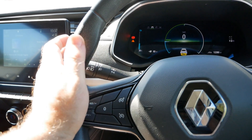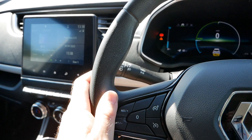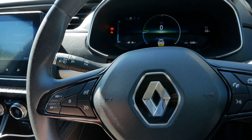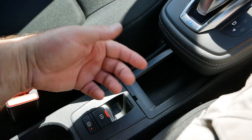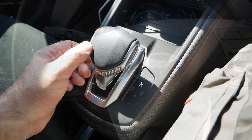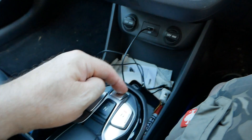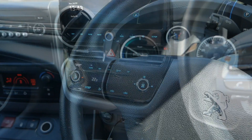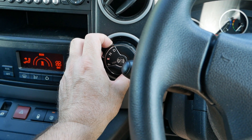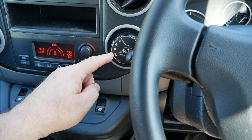In some electric vehicles this isn't an issue at all - for example in a Tesla, every time you select park on the gear selector it puts the handbrake on and automates everything. In some newer electric vehicles - in this case I'm in a Renault Zoe ZE50 - they've done away with the park position completely, so when you stop you apply the handbrake and just put it into neutral. But if you do have a park selector on the transmission, particularly an electric push-button type, make sure the weight of the vehicle is on the brakes and you apply the handbrake before putting it into park. If you hear a clunk going from park into reverse or drive, that's a telltale sign you're putting too much pressure on the park pawl in the gearbox.